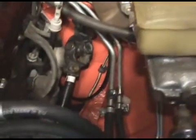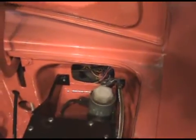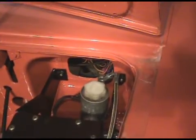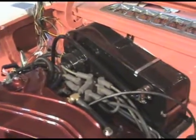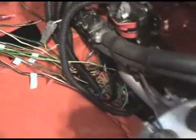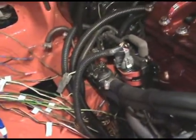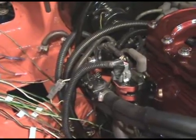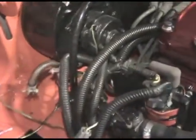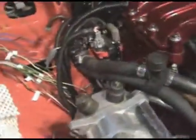The braided line is the clutch. Got a 90-degree up here at the slave cylinder itself, and down at the bottom a custom-made AN3 stainless steel line that gives me a little loop and a little free play. You can see the heater piping following the contour. Amazingly, the heater valve is actually using the original valve — the original MGB cable fits the new valve pretty well. Brass plumbing with 90-degree turns to route it into the heater box. Should be pretty interesting.